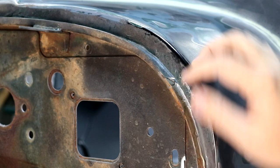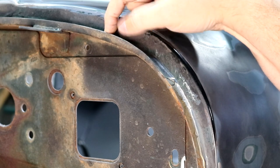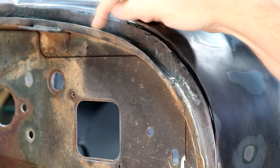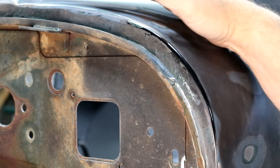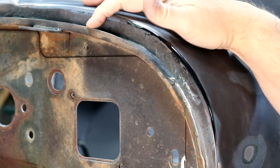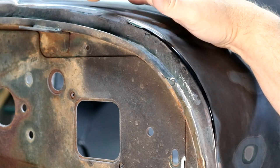But if all that rain is getting into this gutter and this gutter is not secure and watertight, water gets in there, goes back, and actually gets inside the vehicle. That could be a source of a lot of the reason the A-pillars are rotting out: we're just getting excess water you don't even realize you're getting.